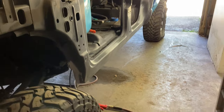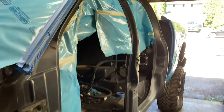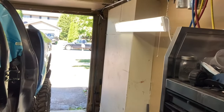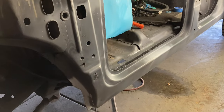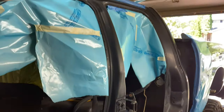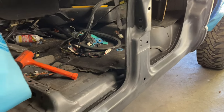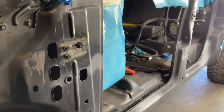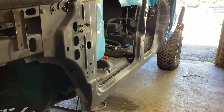We're going to wet the floor to keep the dust down. When you're painting, a huge important thing is light — you've got to have good light. I hung a portable LED light right there, which is going to light up everything, because you need to see how the paint is going on. You need to see if you're going too wet or too dry. So we're going to wet the floor, start mixing paint, and start shooting. We're going to switch to my GoPro for that — I'm going to show you how it's done.